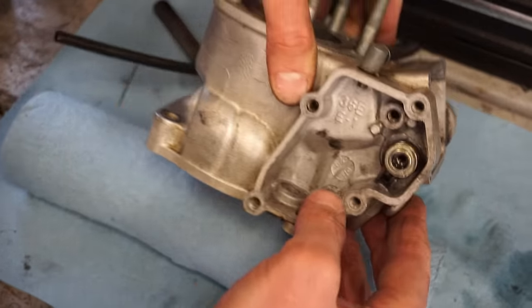Let's go over here. Now, this spring mechanism right here, with this little shaft off of it, is going to be pointing down. A screw that goes into there. Into here. So you can see there on the spring, there's a little wire that sticks out like that on both ends. So you want that to go through the little groove in the end of the rod here. And then the other end, you want to attach to the little groove right there. That's gonna go like this. You can push that in. So right now we're set at zero. Then we will put this on.